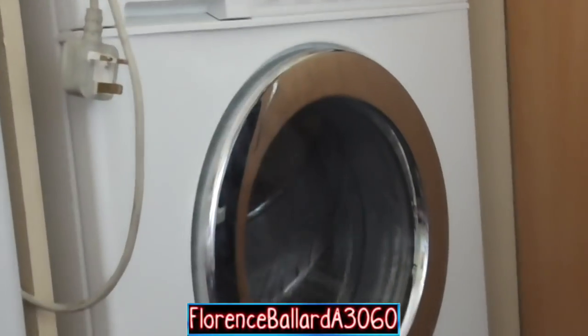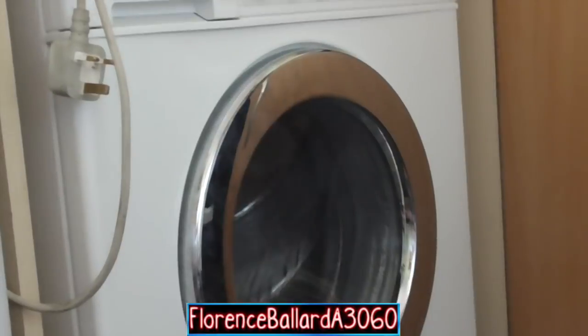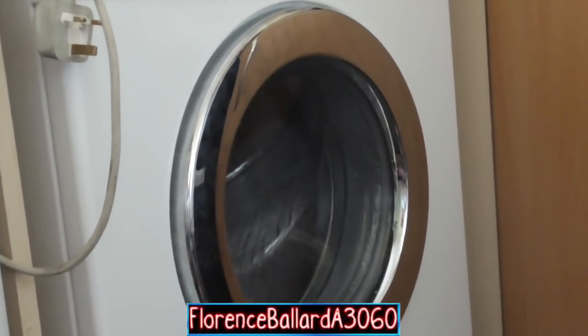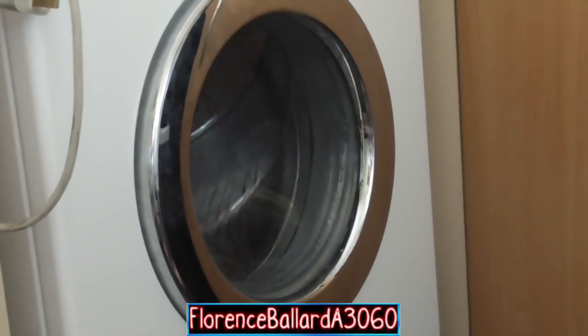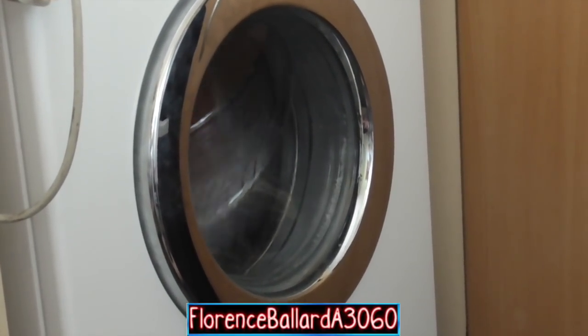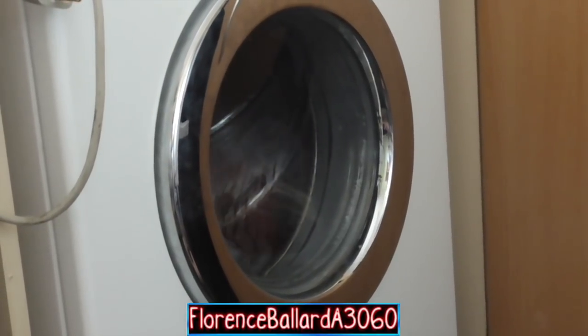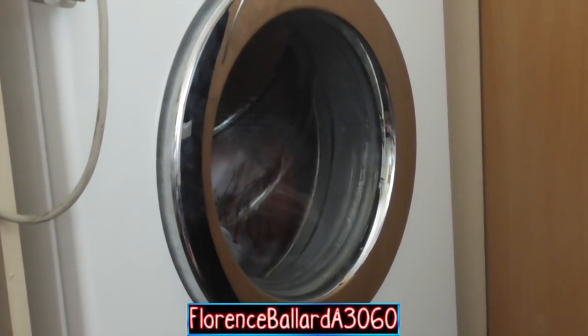The old Mieles had a spin brake. The 1980s models, you know, the Deca panel. Oh doors, yeah. They have a spin brake. It brakes down from about 500 RPM. It goes shoo. It sounds like an Ipso. I can make the Samsung in service mode do a spin brake. LGs have got a nice spin brake. Oh yeah. Yeah, that does quite a good one.